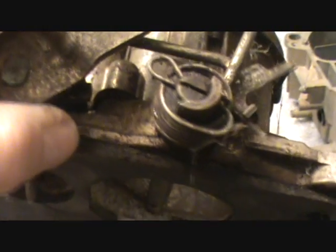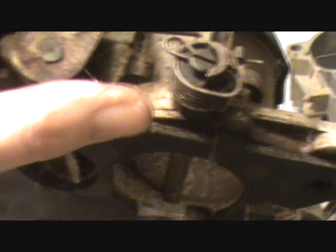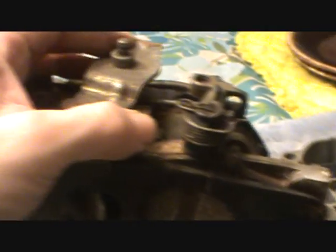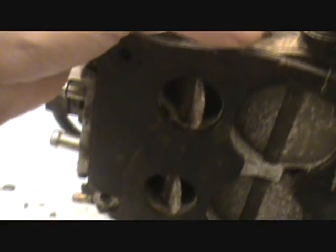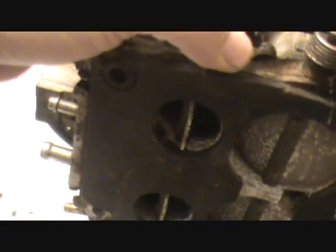See that - it's rotating around it but it's not turning. Now that's designed to be that way, don't panic and think it's broken - it's not. That's supposed to be like that. That's so that you can go ahead and stomp the gas whenever you want to - it may not open the four-barrel up, but it won't prevent you from going wide open throttle on the primaries. It has to be that way to be able to get the primaries open all the way.